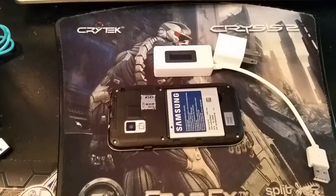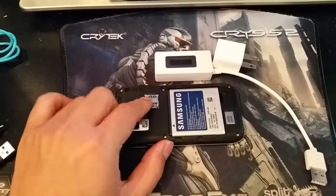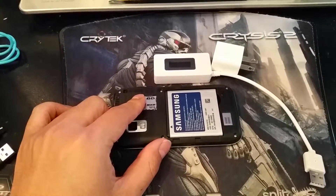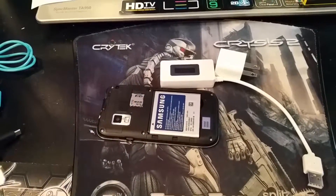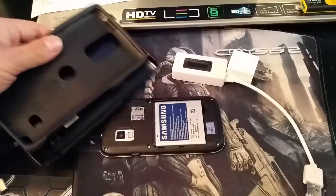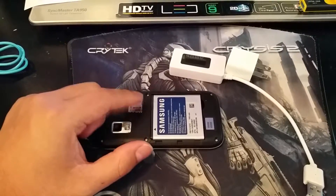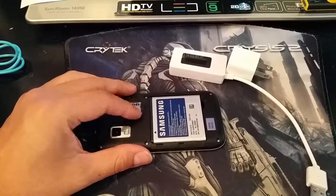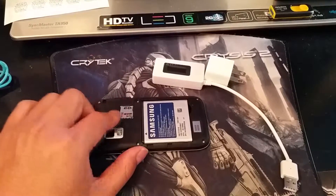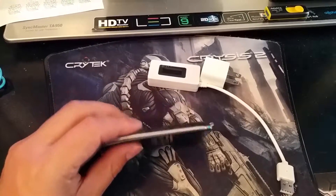What about your phone getting hot while charging? A couple of reasons: one, apps running in the background are overworking the CPU. Another reason is charging overnight in a poorly ventilated spot — if it's covered by a pillow or blanket it can get hot. A phone case while background apps are running can also cause overheating. Before charging overnight, disable all background apps, put the phone in airplane mode, or turn it off, and make sure it's in a well-ventilated area.